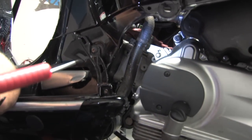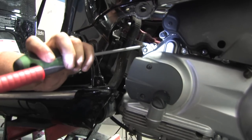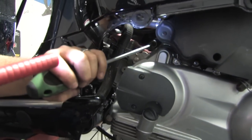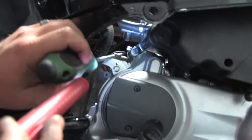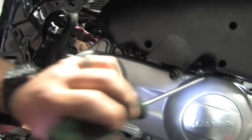Okay, so we've got our motor reinstalled. To show you everything that we've reattached, there's obviously the one little special bracket that holds the cooling hose, which shares one of the belt cover screws. We've got all the belt cover screws installed. Taking note of the one airbox fastener up there, again, that's the longer one, the black one, where you have to reach through from the backside and install the flange nut. So that's done. The topmost airbox screws are the other two, one and then two there.